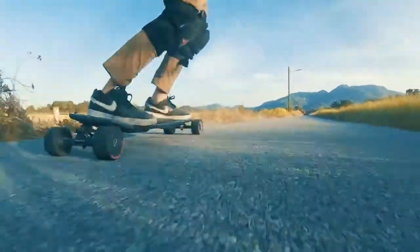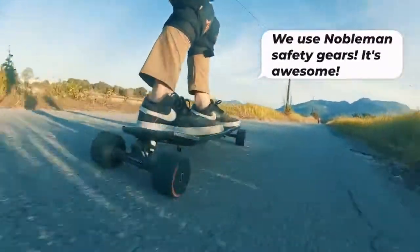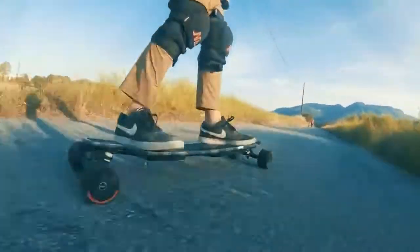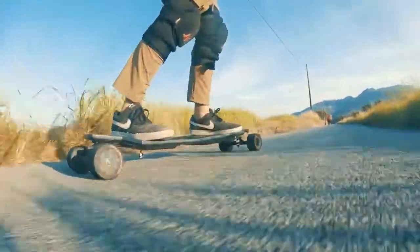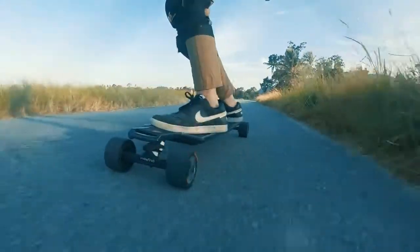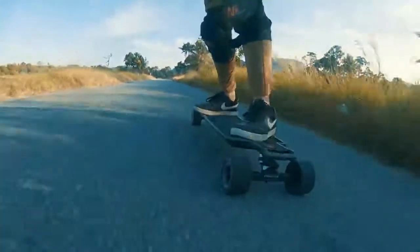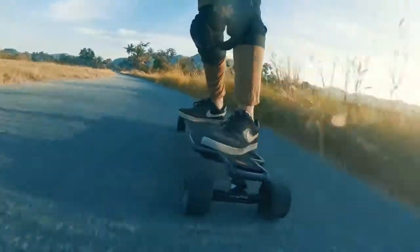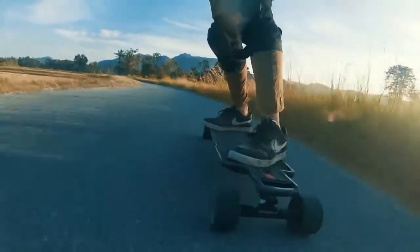These trucks have poor rebound to center, and this makes carving less fun. If we tighten the trucks all the way down, the board becomes hard to recenter after a turn. Inversely, if we ride the trucks loose, the trucks will easily wobble at higher speeds. We can't seem to find a good configuration with the trucks. Perhaps changing the 98A bushing is the way to go.